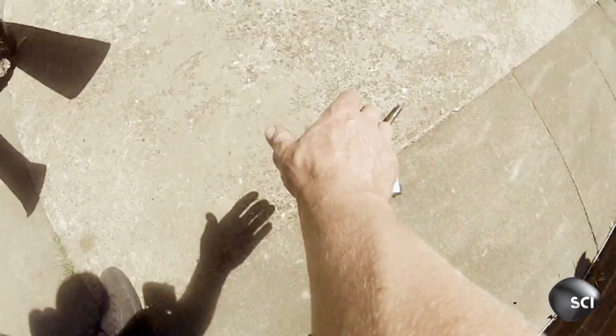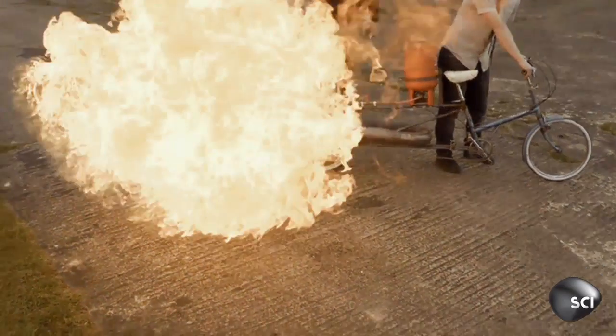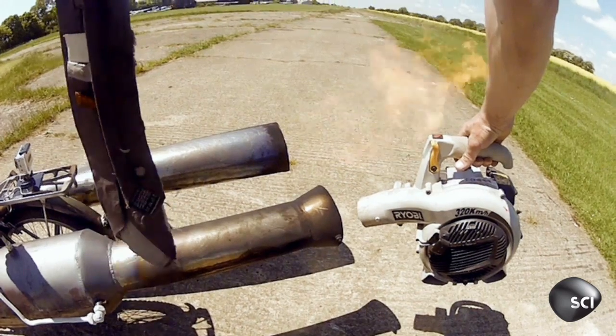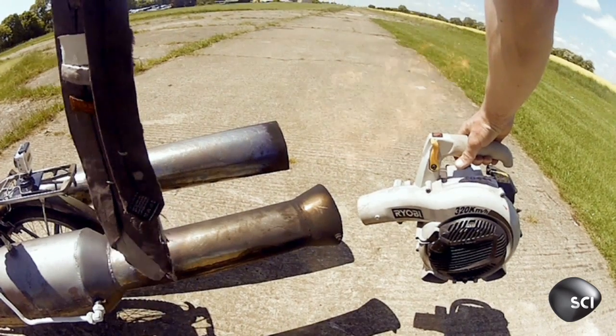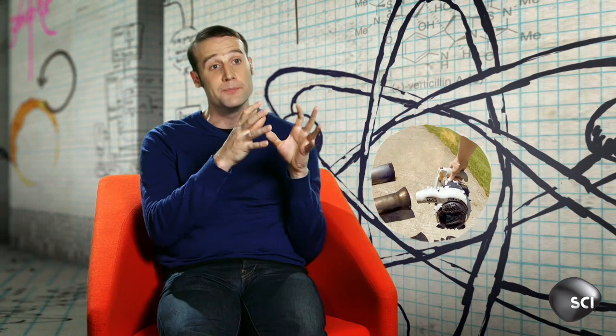The fuel is introduced into the combustion chamber. That fuel seeps out through the exhaust and he lights it. When they first set the fuel on fire, you see a large orange flame come out the back. This is because there's not enough oxygen in the pipe for all of the fuel to burn. To fix this, Colin uses a leaf blower. The leaf blower is effectively the same as the turbine in a normal jet engine — it forces a lot of air, bringing a lot of oxygen, into the combustion chamber so that all the fuel burns completely and forces the bike forward.